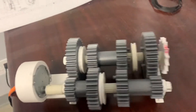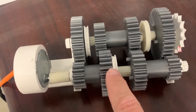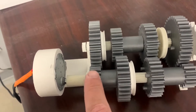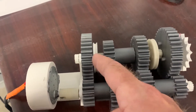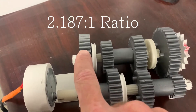Here we have third gear. This slider has moved from these dogs to the dogs in this gear. So the drive shaft is powering this slider, which is powering this gear. This gear is connected to this gear. This gear is driving this one, which is driving the slider, driving that spline, driving the output shaft. So the central gear ratio is from this gear to this gear.